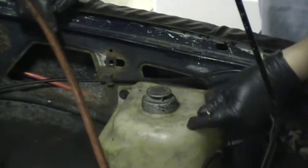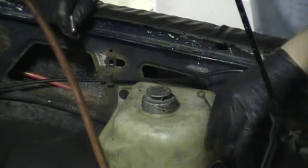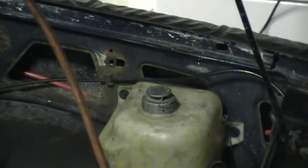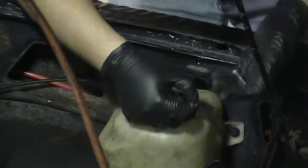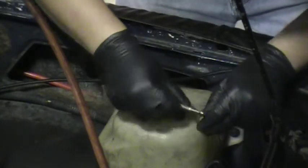Washer, that's good. I'll bolt it on. And I'm going to need to drill out these connectors because they are not big enough to fit through this bolt. So now I need a smaller bolt. Okay, I actually found a smaller bolt that'll work, so I'll just use these for the ground. That way I don't have to expand the size of it. It'll fit through just fine.